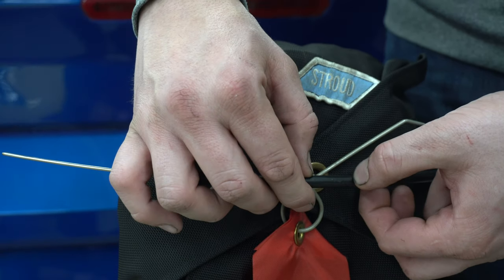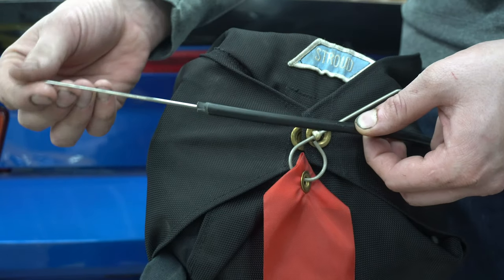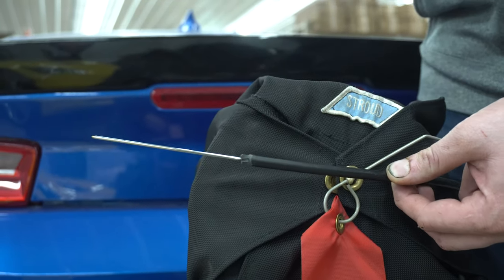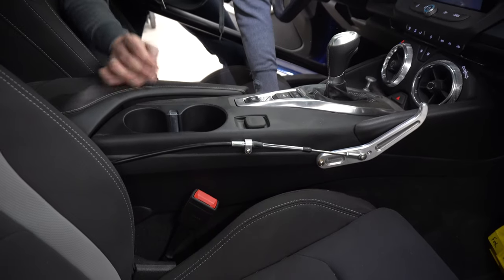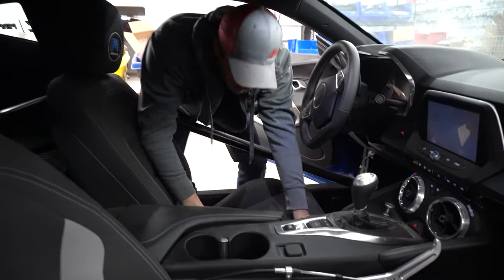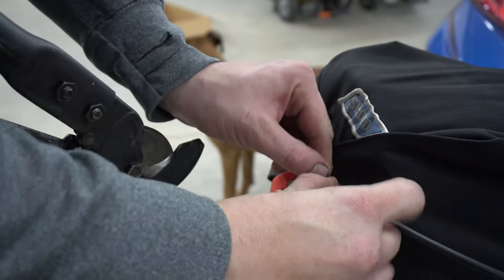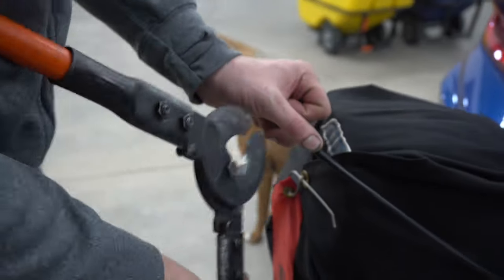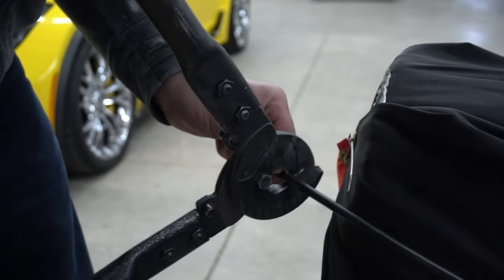So what we'll do is just kind of mark that — we're gonna have somebody inside the car pull the handle back, basically as if they deployed the parachute, they're gonna push the handle back. Just act like you are deploying your cable like you would hit it, so that's gonna be the amount that gets thrown, and then we'll go right back to the back of the car. Since we pulled that back, we're gonna put this back up here and just estimate it right there. These bolt cutters work really well — otherwise you can use a cut-off wheel or any type of real strong cutter — and we'll just chop right through it.